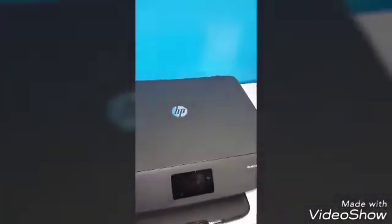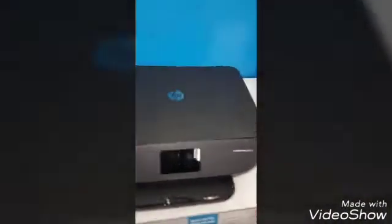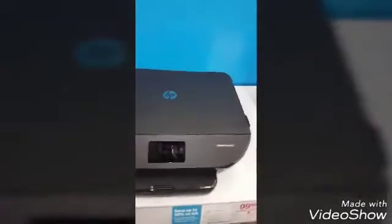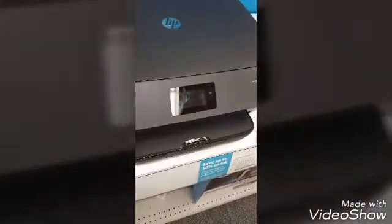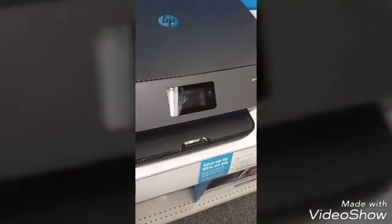All right, I'm back. I tried fooling around with it for a little bit — that did not work. So what we did is we unplugged the printer for about 30 seconds to a minute, also with the ink cartridges out. We have our old setup cartridges that are not working. What we're going to do is plug it into the printer, give it power, and then hold the power button down until you see some lights come up.